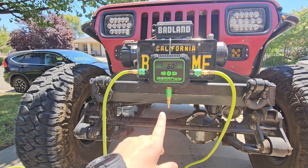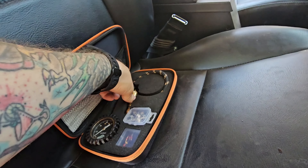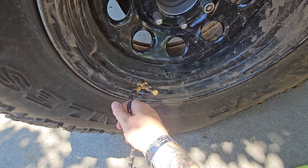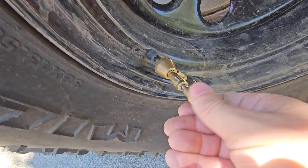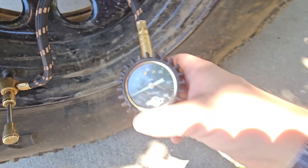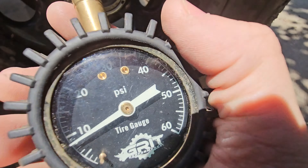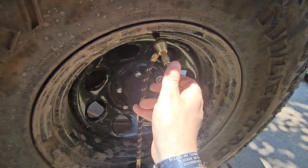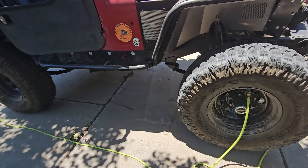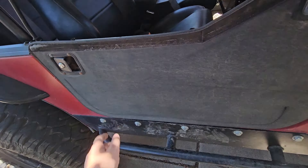Alright, it's showing — there we go. Four minutes 30 seconds to get down from 20 PSI to 6 PSI. Here's my old-school Grip Performance valve stem puller. The tires do look like I expect for 6 PSI. The gauge is showing 8, so if I was going off this gauge I would take it down two more PSI. The front tire is showing about the same. One way to compensate: just air down a little lower, set the Air Hub to 5. We'll have to experiment the first couple times, but it is pretty close and pretty hands-off.